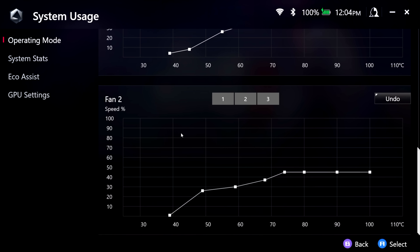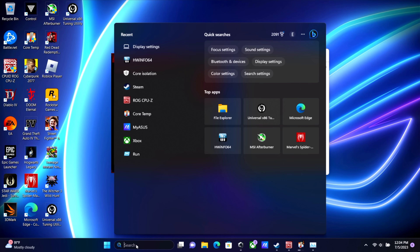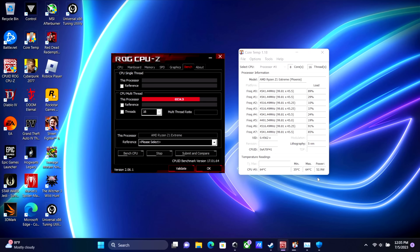If you were worried about heat or anything like that, we've got a fan curve on both fans that you can fully adjust. While in dock mode I'm always in manual — want to get the most out of this thing. There was one other thing that I did which actually seemed to increase performance in a lot of games: core isolation from the Windows settings. Microsoft does suggest turning this off for better gaming performance, and in some cases — for instance, Cyberpunk 2077 — I got a 9 FPS boost just by turning this off. Running at such high wattage, I use Core Temp and CPU-Z and will just stress it out. You'll see jumps up to 52 watts, but it'll slowly creep back down to around 42. So we can do 42 watts on this APU while gaming, and it really does make a huge difference.